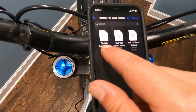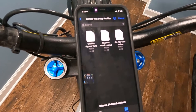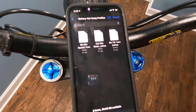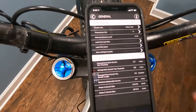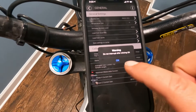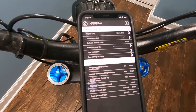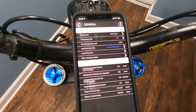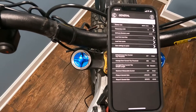You have the option of a 60-volt bypass, which allows you to draw more current from your battery, your 60-volt stock parameter, and your 72-volt. So let's say you've got your 72-volt battery in the mail — you put it in the bike, pick that profile, and it says 'Warning: do not interrupt after clicking.' Click OK and it starts loading that parameter into your bike. It doesn't take very long. Once it's done, power off your bike.